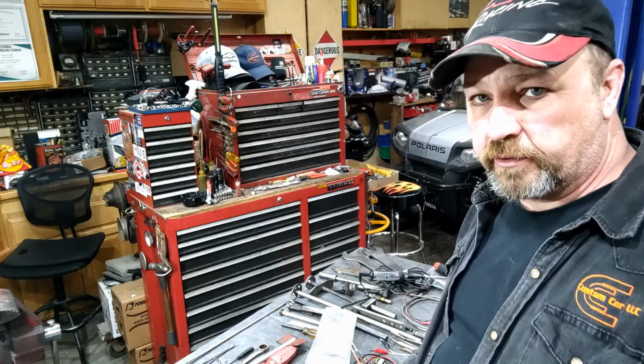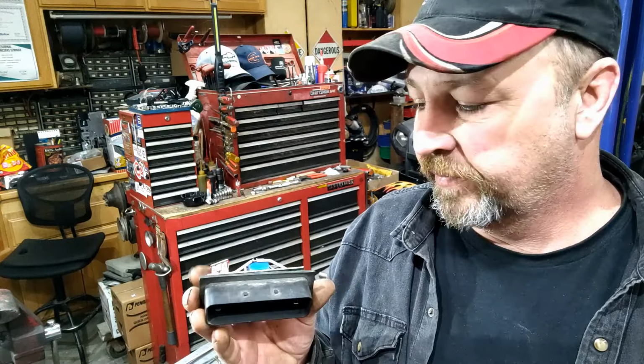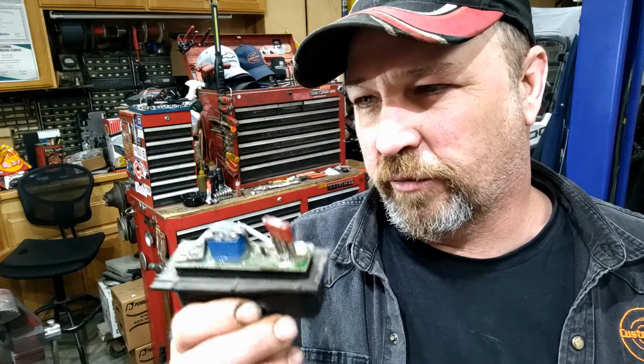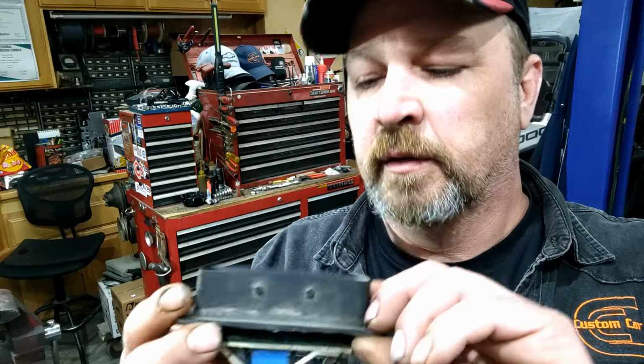And then we're getting down to it now, and that's good. So the first time I encountered a fuel pump module on a Chevy, it went bad. I made this. So if you're thinking the module's bad, which they're always bad because they get water in them, I just plug this in and it tells me if I'm getting power. And then it'll take key power with this little terminal right in here, the little one.